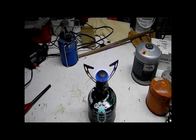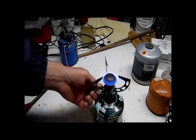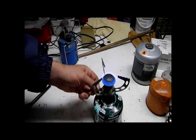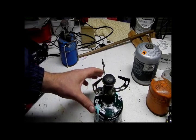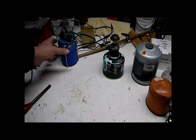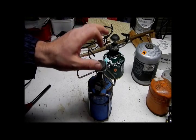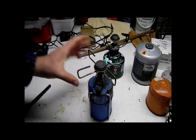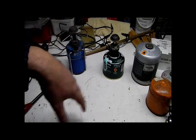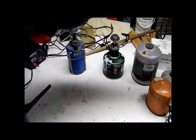that's a pretty intense flame. It probably is close to 14 megajoules, but to put that into perspective, that's about 14,000 BTUs to the Americans out there. To put that into perspective, that's about the same size as a wok cooker on a standard domestic cooktop found in Australia. It's very big for the size of the burner. The old one would have been around about 5,000 BTUs, or 4 to 5,000 BTUs, probably closer to 4, which is 4 megajoules an hour. We can go through how much gas they burn later, but that gives you a bit of an idea.